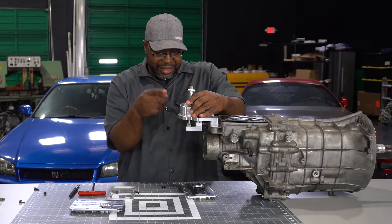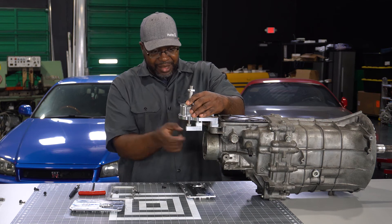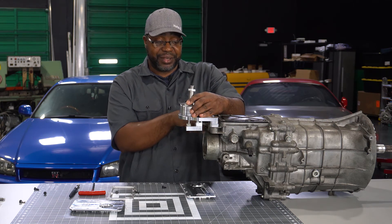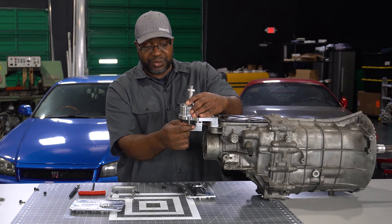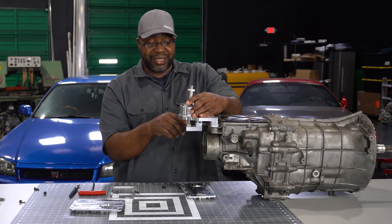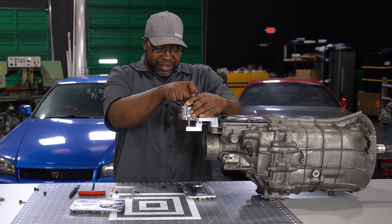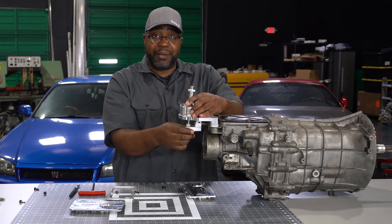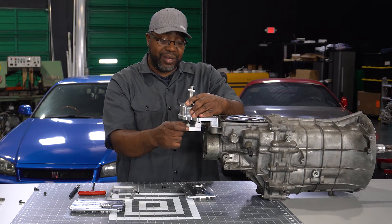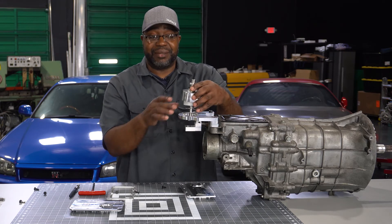As you can see right now, using that many spacers on this particular transmission we're sitting too high. That's where having the spacers for adjusting comes in — I would eliminate the spacers and this one will drop down into the middle. You basically want to use a spacer configuration so that when you push into reverse it barely pops out or doesn't pop out completely, and it's still within its range of movement inside the linkage coupler. That's how we set up the spacers.